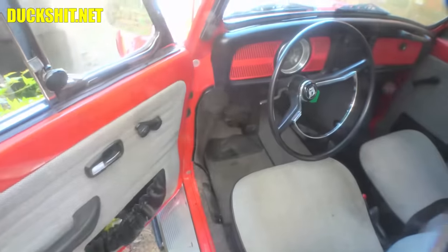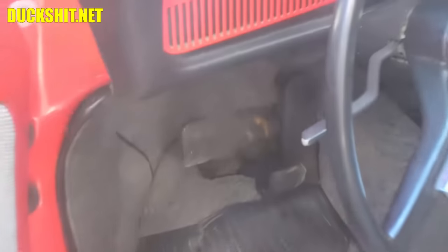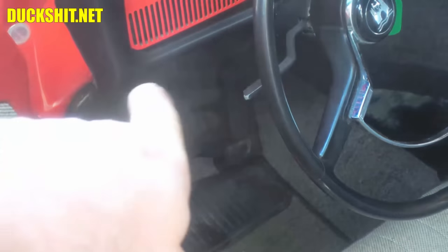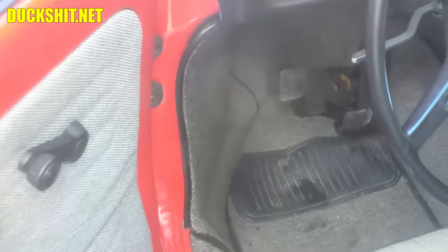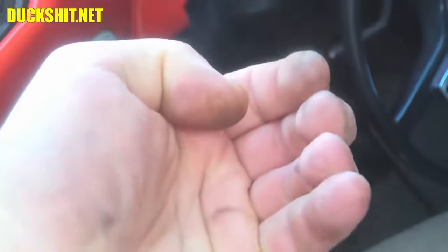I need to address the pedal cluster down there, which is usually the 13 millimeter bolt that goes straight down the back of the pedals and into the floor. And it's on the other side of the pedals, forward of them. So I'll get in there and loosen it. There's a little L-shaped bracket with the bolt going through it, and it's probably turned that way, which is allowing the pedal to go all goofy. But anyway, I'll get that fixed.